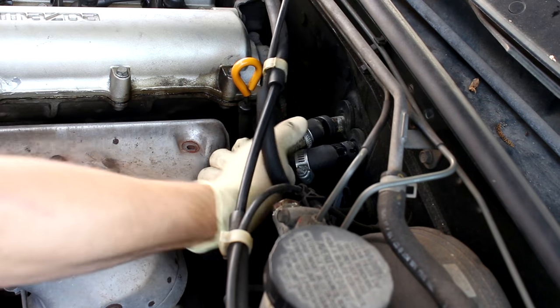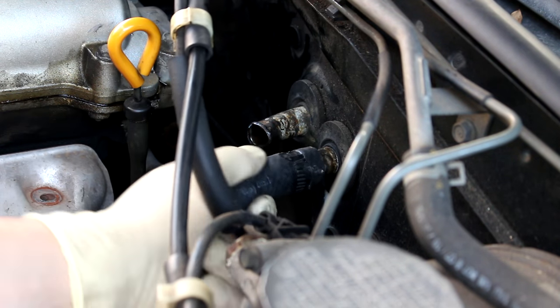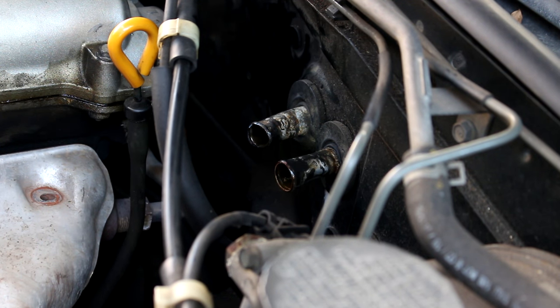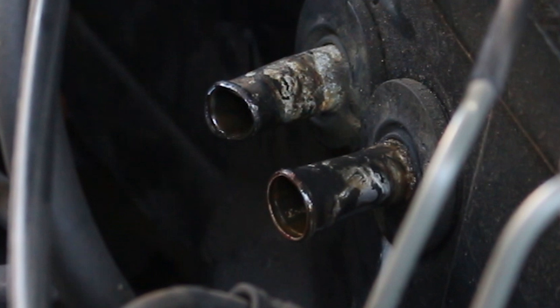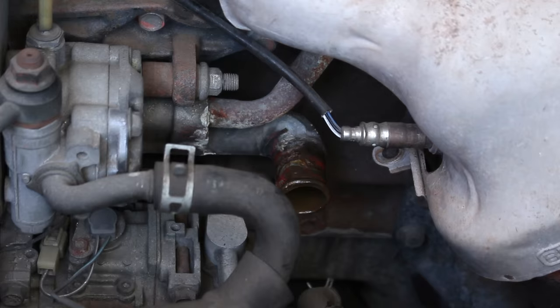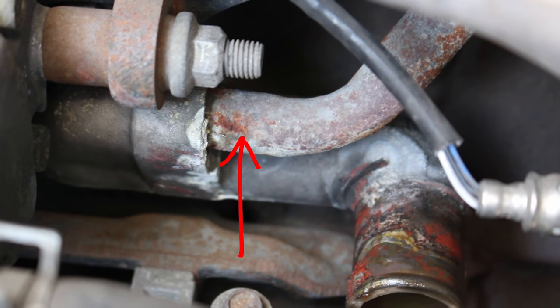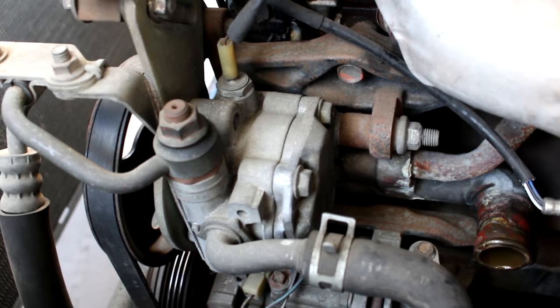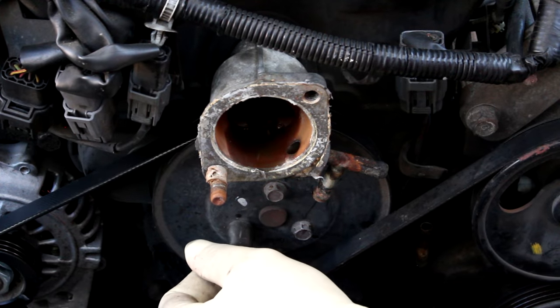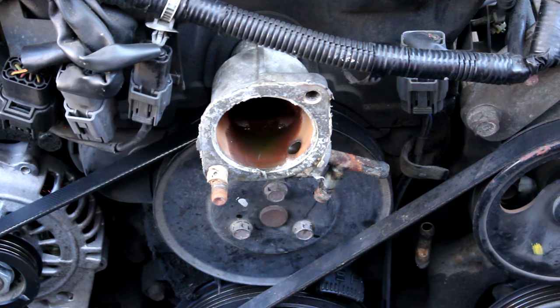Next, remove the heater core hoses. This is pretty straightforward; if they're stuck, you can cut them off with a razor blade. You can see this thing is absolutely crusted out. You don't want to use any crushing force to remove the hoses off the hard lines that come from the firewall — those are pretty easy to damage, and the NBs are still susceptible if you get too aggressive. Remove your lower radiator hose, and then there's a hard line that goes back from the heater core hoses up to this mixing manifold that sits behind the power steering pump. That tube is actually bolted to the exhaust manifold. You don't have to remove it to do this job, but I'm going to unbolt the power steering pump to gain access and make this whole area easier to work with.